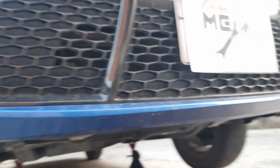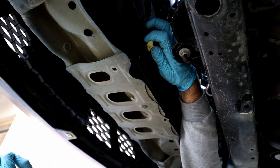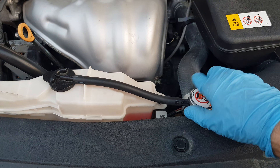Here is the drain valve located on the Toyota Camry — and most cars have one here. If your car doesn't have one, remove the lower radiator hose to drain the coolant. By removing the cap, it will drain faster.